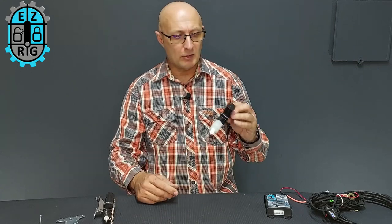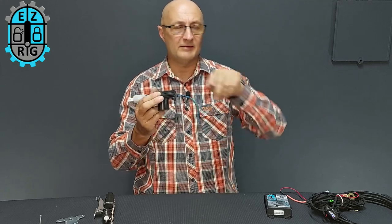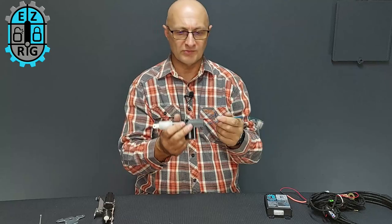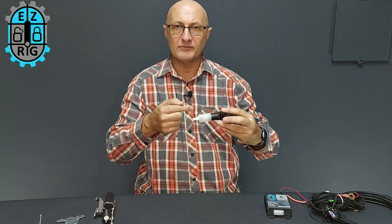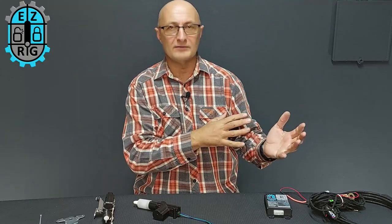What they typically do is take a standard off-the-shelf central locking motor, splice and dice the wiring into one of the doors, fit it on a plate, and add a little locking lever that just jams behind the handle. It seems like a good idea and it works — if you lock the vehicle, the tailgate is locked or the handle is jammed.